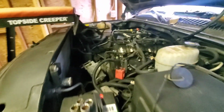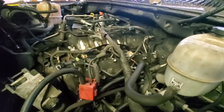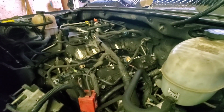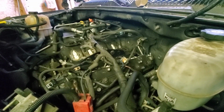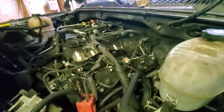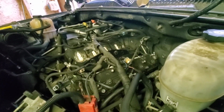Cleaned it up good. And the bearings in them look really good, so I may just open this up, depending on what we find. I'm anticipating either a bent rod or a broken piston skirt, and we may just put that set of LQ4 Gen 3 rods and pistons back in here to get it going again. They're in really good shape, so I would definitely put new bearings and rings.